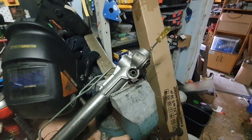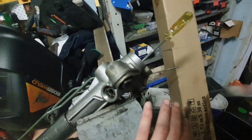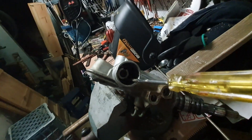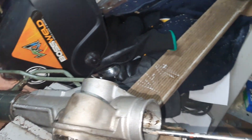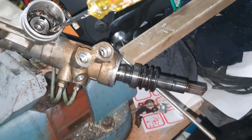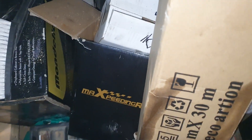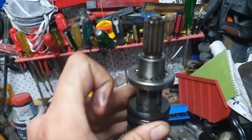So finally I have some real banging — I've got it apart. It was really hard. I didn't have it in the best position on the vise so I didn't have a clear swing on it. This time I gave it a few more confident taps and I've got it out. I used the screwdriver in there to pull the actual rack as far away from the pinion as I could, so I banged it out and it's come out. The only downfall is I heard a little pop and it seems I've lost my bearing off the top. So I've got the pinion out — I've only seen one piece of bearing so far; I'm assuming that's what it would be.